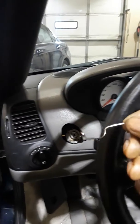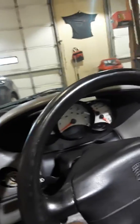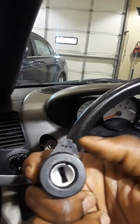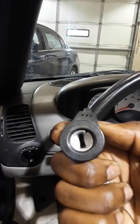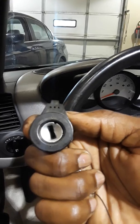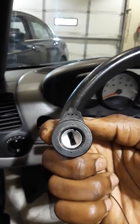I've got this paperclip, and on the ignition cylinder itself there's a small hole on the right side. I've already taken it out, but you can see — there's that tiny hole up top. Not the hole on the rubber piece, but the hole that's right there beside the keyhole on the top right. That is where you stick the safety pin, but the key has got to be in the accessory position — right before you start.